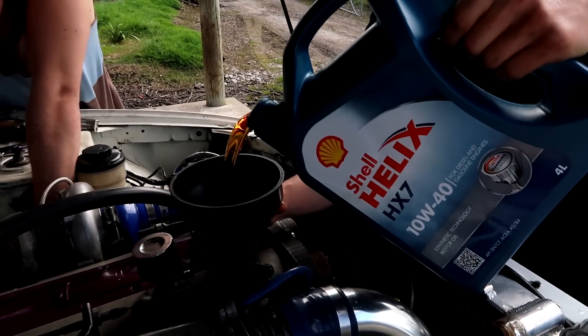Running smooth. Let's give it a bit of a rev. A bit of lift there but it's normal. Oh, it sounds healthy - good oil pressure. Something is nice - running it in at 2k revs at the moment, get the temperature up, recheck the timing.